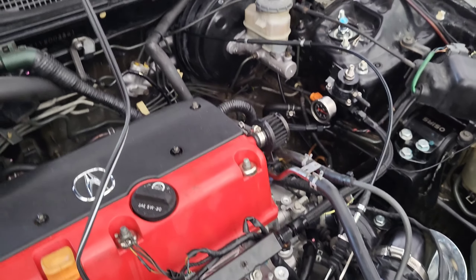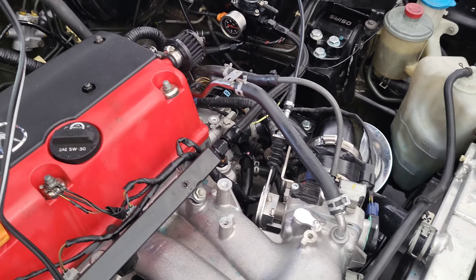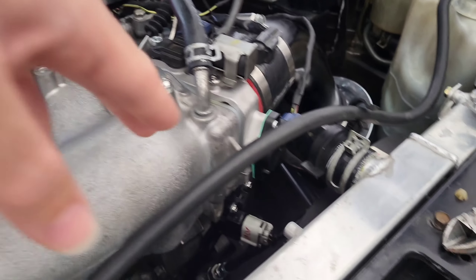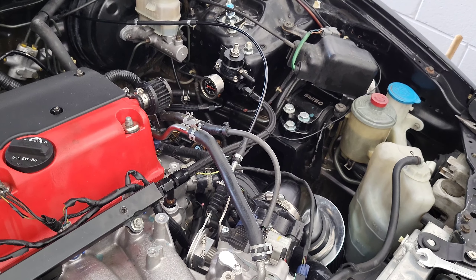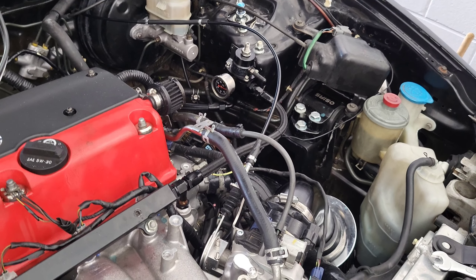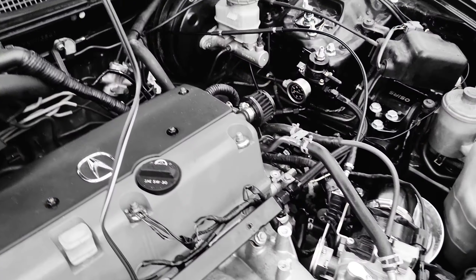The cable install is done — you can see it's already in there. It's calibrated; I probably could move it a little bit more, but I'm going to leave the TPS at that. It's a Dorman unit and I got it calibrated to 91.4%, which is perfectly acceptable.